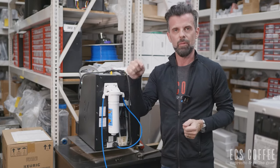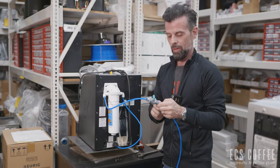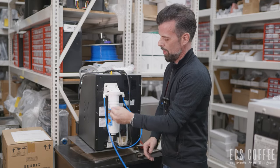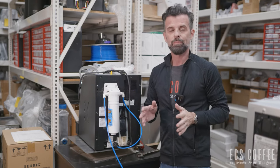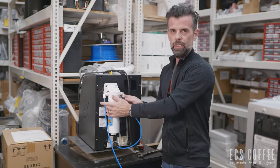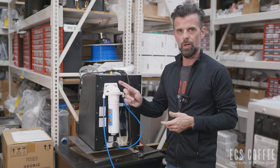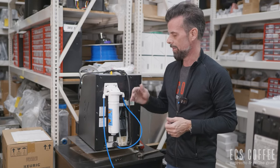So to recap: from under the sink we've shown you the blue line coming up. We've added a shutoff for safety that came with the kit. You then come out of the shutoff into the filter — water goes through the filter, comes back out, and into the machine. Do all of this with the water off, then turn the water on and check everything for leaks. Then turn the machine on. The filter will have some air in it, so water is going to push through — sometimes it makes an error in the machine. Just turn it off and back on again and you should be good to go.